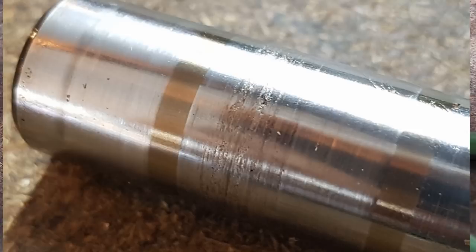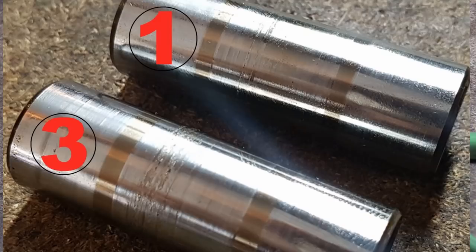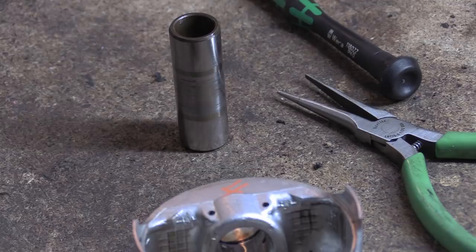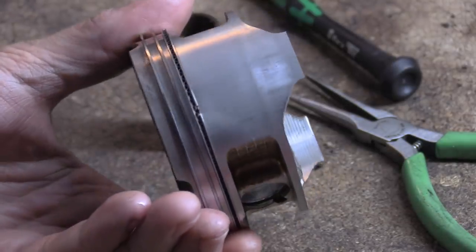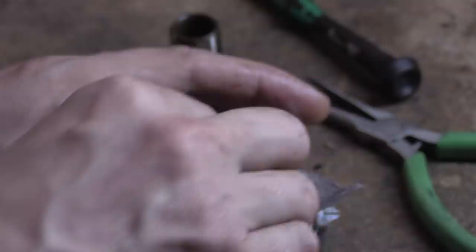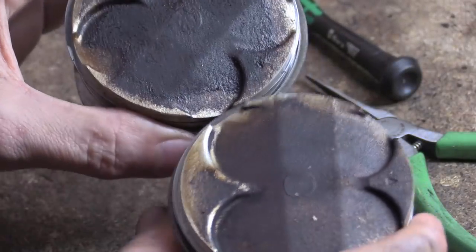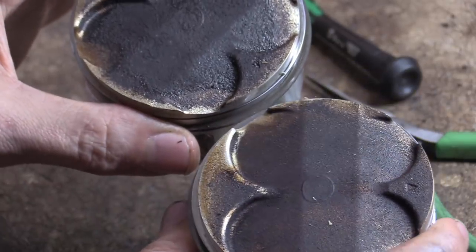Let me compare number three versus number one. Number one — oh, I shouldn't have dropped that in there. These are done anyway, but ideally you shouldn't drop them. Piston number four — nothing major. Compared to detonating Ducati pistons and stuff like that, these are completely fine. There's a bit more carbon on this one, but like I said, there's always going to be one that's the worst and one that's the best. What you're looking for is massive asymmetry. Maybe this one is leaking a bit more oil or running slightly hotter.